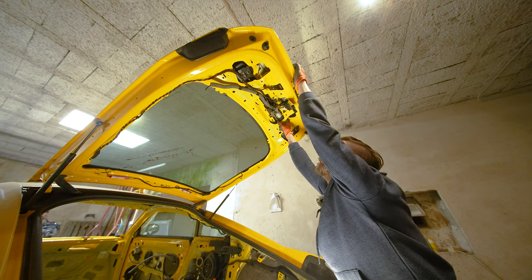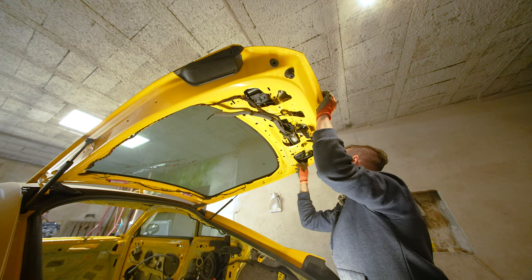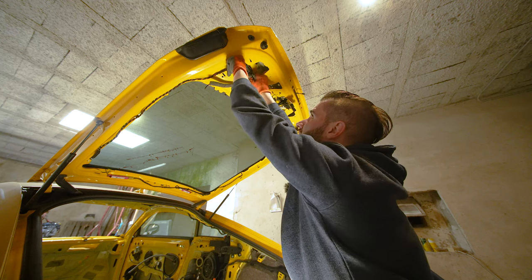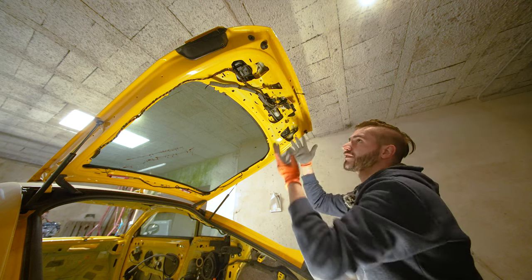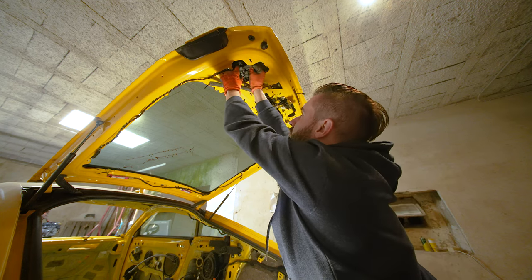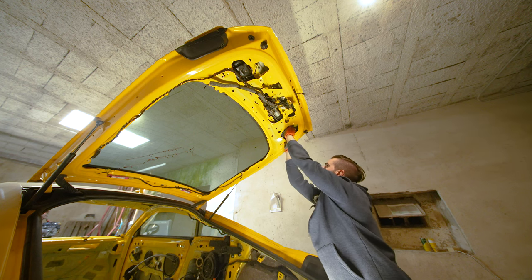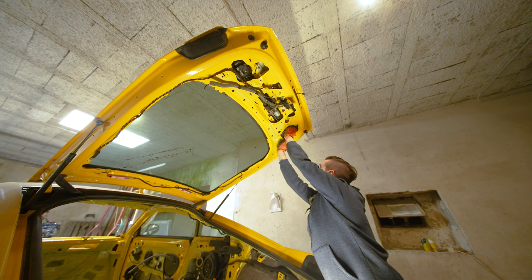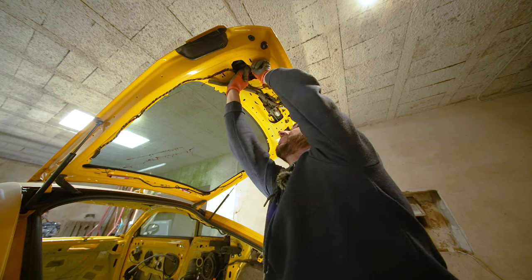Now everything is out. The spoiler still seems firm — maybe it's already glued. Maybe the 2015 model wasn't so bad after all. A gentle push will unseal the original seal and allow you to remove the spoiler. I just realized we also need to remove the drain hoses off the spoiler first. With a small flat head screwdriver they are coming off really easily.